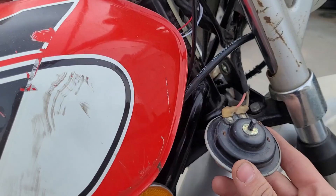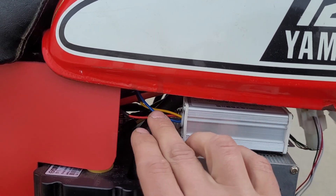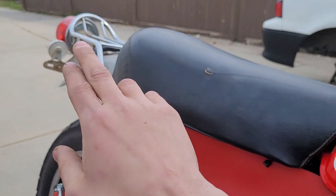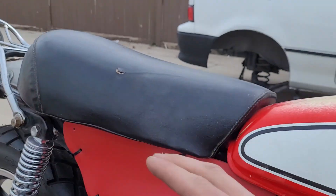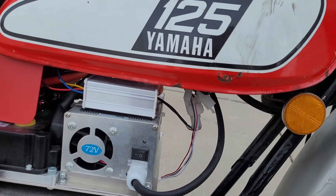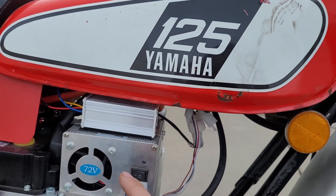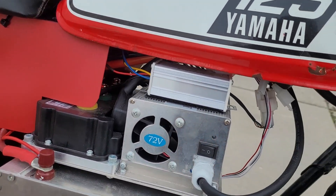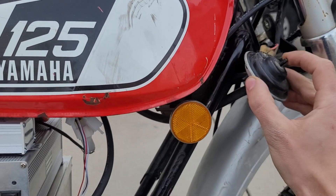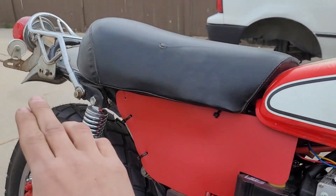This horn is the last part of the project I have to do. Since I have a DC-DC converter, it does not isolate the high voltage from the low voltage side, which means it has a common ground. The tail light and headlight are not grounded directly to the frame, so those all function fine. But this horn is grounded directly to the frame, and I want to isolate that — because if I were to touch the main positive and the frame, I would get shocked. So I need to run the horn with an isolated ground directly to a wire, just like the headlight and tail light are.